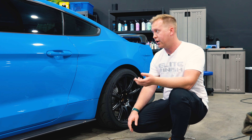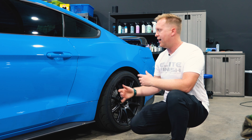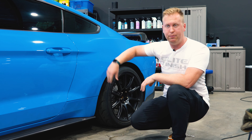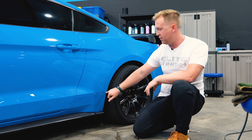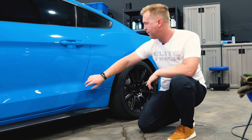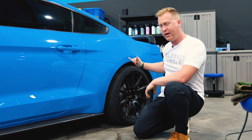We're also going to be doing the extended rockers. There is an option to do the entire quarter panel, which comes with extra cost, and based on the budget of this car and the fact that it's being tracked regularly, it's nice to have parts of the car where we can just rip off a piece and put a new one on as it gets beat up. We're doing the entire rocker panel through here, stopping it at the body panel, then doing a larger piece back here — starting on this edge, wrapping around the front part, coming up to this body line, then bringing it down and around to hide it as the light curves around the panel.